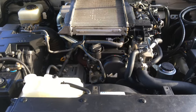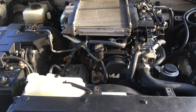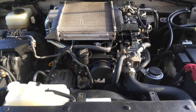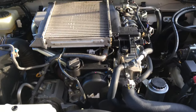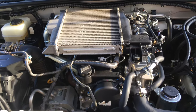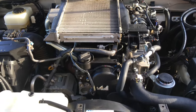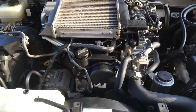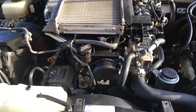When it's new it might be okay the first time in five or seven years - they recommend 160K. We do the BFE every 150K. But once you get to the second one, 150K onwards, I recommend a coolant change at least in between, or every two to three years. Because everything's not new anymore and you only get about 80% out - it's good enough, but you need to do it regularly to keep it flushing.